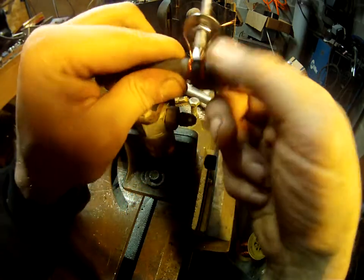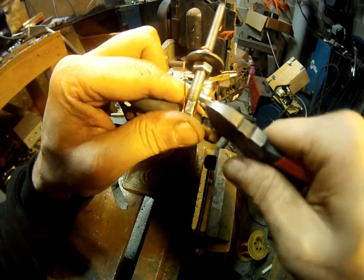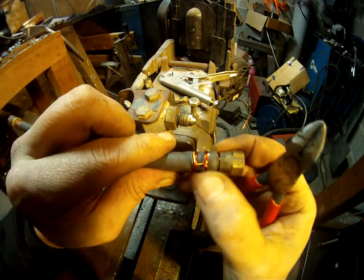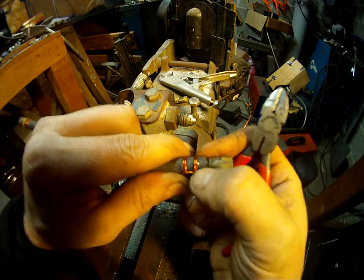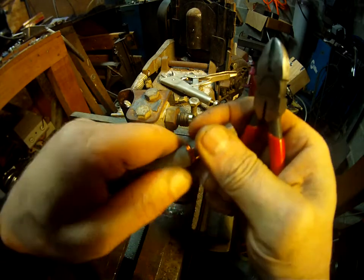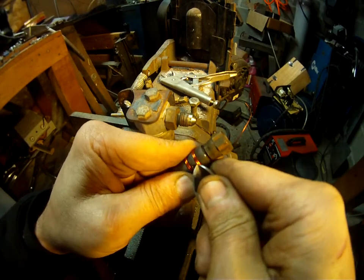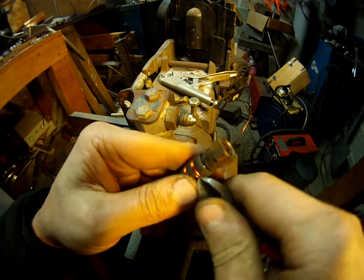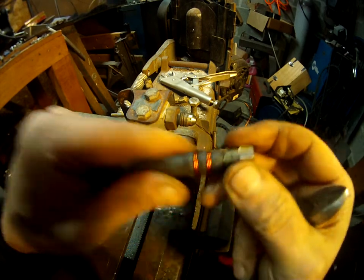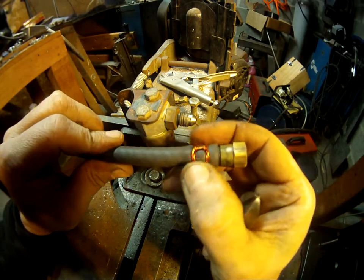Okay, that little twist. So you can take your cutters and cut down here a little bit. Take your tool off and see how it's captured on there. And with this soft wire, it's really easy to bend them in. And you just poke the tails down in the little groove you made, and that'll stop you from getting poked and cut, and they're flush. And there is a homemade hose clamp.